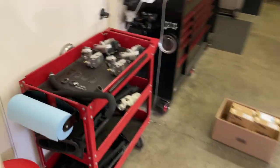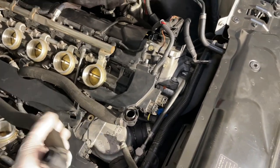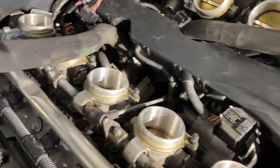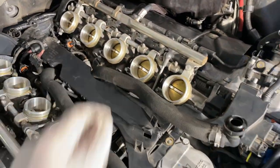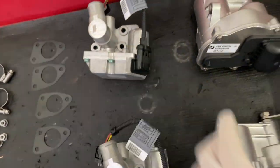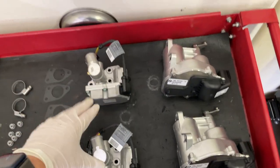Let's look at the parts that just arrived. We're going to replace two hoses — a short one for bank two and a longer one for bank one — which snap into the wiring harness and attach to the bottom of the intake plenum, connecting back to the idle actuators. We've also got profile gaskets for the idle actuators and the two throttle actuators and two idle actuators themselves. All part numbers will be in the description below.